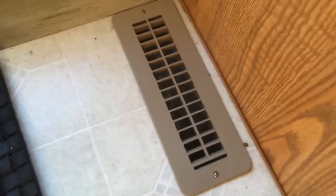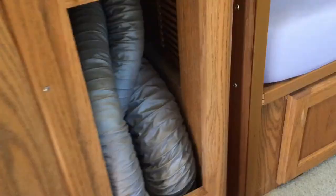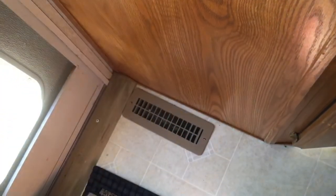I've got another vent over here by the entry door and this one gets really dirty. All of your vent hoses are kind of like dryer vent hose underneath the coach. At least on my camper, some of them are hard plastic conduit, but most of them use this flimsy dryer vent aluminum venting. Don't try to poke anything down your floor vents to clean them out — for example, those dryer vent brushes — that'll rip a hole right in this stuff.